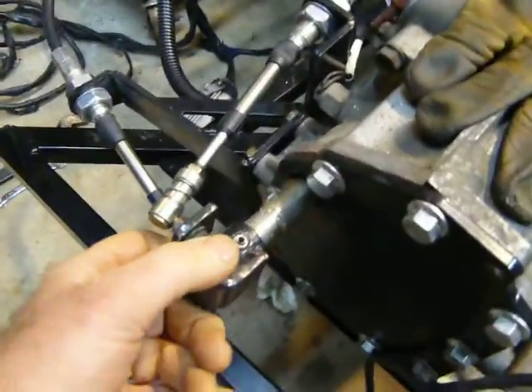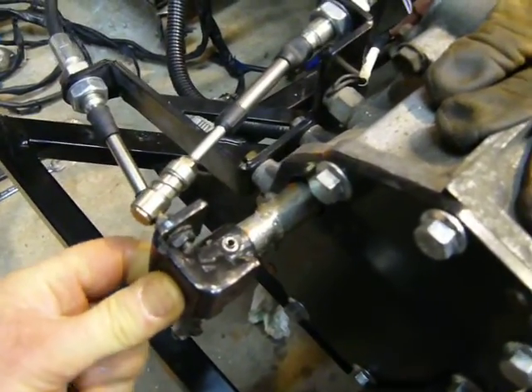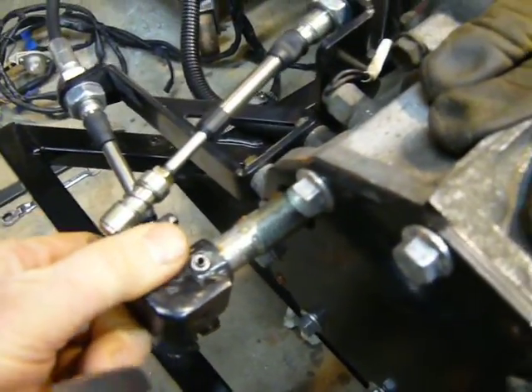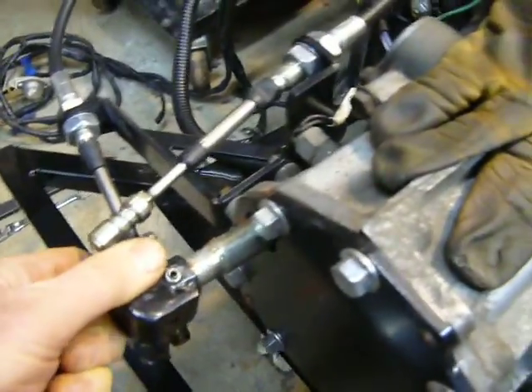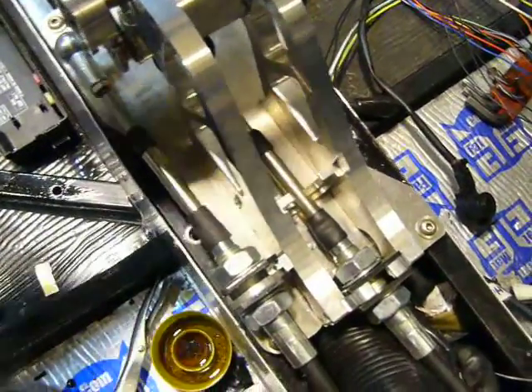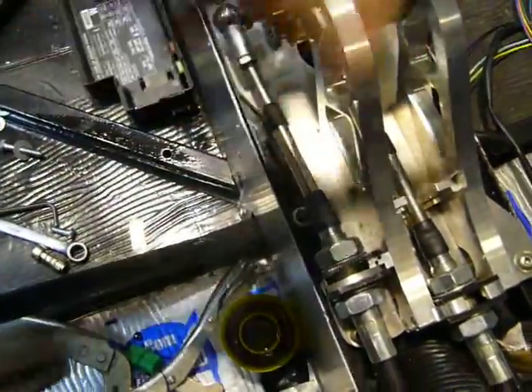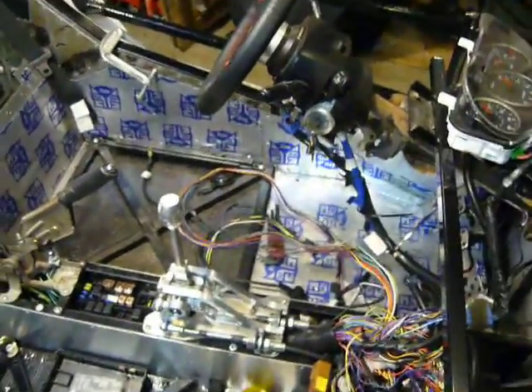As you can see, it moves quite a bit — there's that much slop in the mechanism. Everybody can see at the back that this is how much slop there is. For this much movement here, which is only maybe 40 thousandths of an inch, we're having maybe a quarter of an inch here at the knob. That movement versus there is made up in the cable shape distorting in the big long curves.